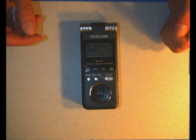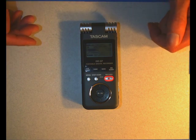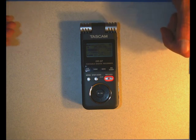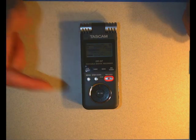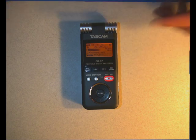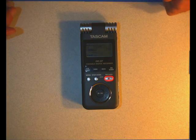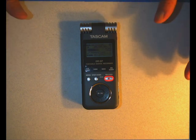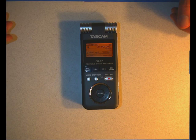Once you're there and you know it's about two thirds and everything's going to be happy, push record one more time and you'll notice that now it's a solid red and it's recording — it's making a file right now. It should be set to MP3 at 44.1. This is recording in MP3 as we speak. To stop recording, you can hit stop/home or hit record again, but you'll notice it's flashing — that's because that's a pause. So if somebody says hold on for a minute, you can pause the recording, sort things out, and then start up the recording again just where you left off. When you're completely done and you want to have this be an MP3 file, hit stop/home and it'll stop, write the file, and there you go — your first MP3 is ready.